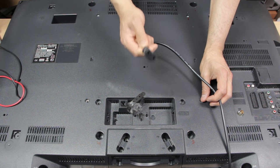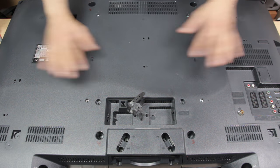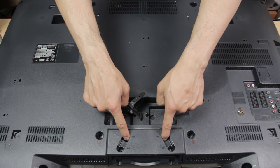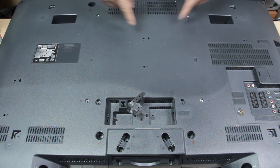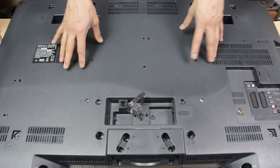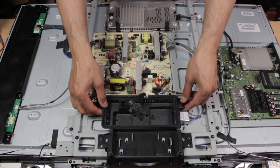The next stage is we're going to open the back cover. With most TVs there are screws which hold the back cover — any screw you see, just unscrew it. For this TV there were four screws holding the stand; I've already removed the stand. Go around and take every single screw you can see. There are only three main types of screws for this kind of TV, so find a way to mark which screw goes where — you could draw a diagram or write on the TV itself — it'll be easier to put back together later.